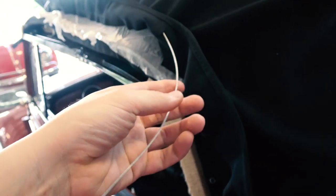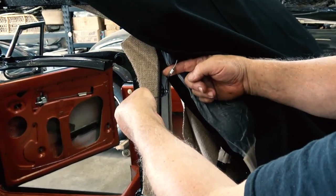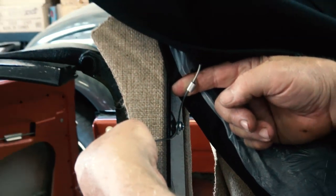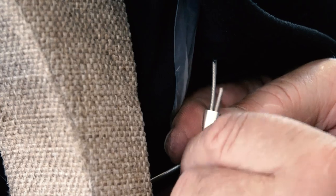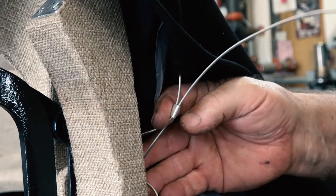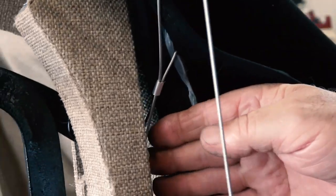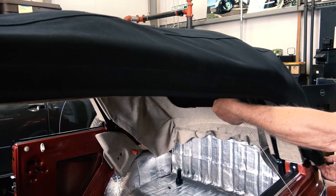Here are your side tensioning cables that we showed you on the previous chapter that feed through the top. I'm pulling it through and I'll show you what this does. You're going to want to tie this back on the outside facing I showed you on that screw. There's your loop — a little doohickey that comes in the kit with the wire, makes that loop for you. Pull that through to make a nice loop to go around that screw, then just pull that slider down and that'll keep it tight.